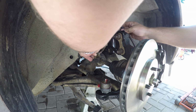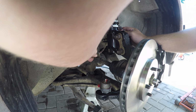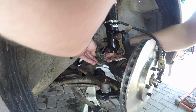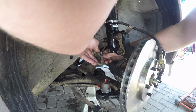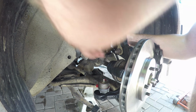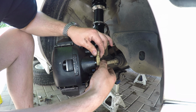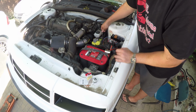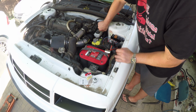Just make sure that you have your flare fittings connected well where the hard line meets the flexible brake hose. There is a clip there that you need to have reinstalled so that it doesn't vibrate around and cause a fatigue failure. Don't forget the 10mm bolt that goes into the strut, and make sure to crank them down nice and tight at the calipers, ideally using some new copper crush washers. Once you get the bottom side of everything all set, you can go ahead and remove the master cylinder.